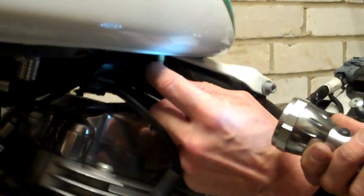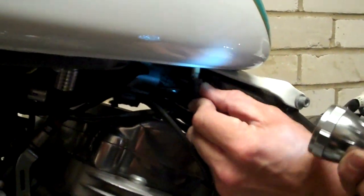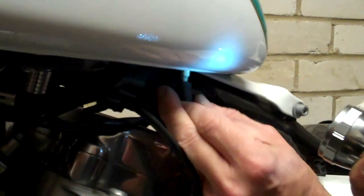And that is when you overfill it up in the top and it pours around the side of your cap, it comes down through an inner steel tube to this. And all you do with that is pull it off. That's some of that where we had it painted. And that's simply your overflow tube. So that just comes off and it will just sit there and boogie around. Okay, so there's your overflow tube. That has to come off, otherwise it will stop the tank removal.